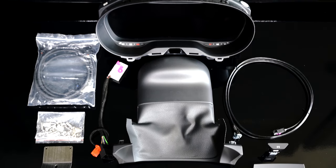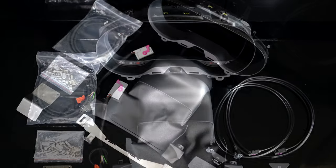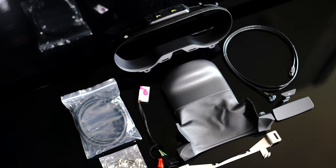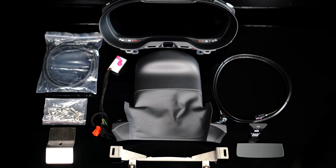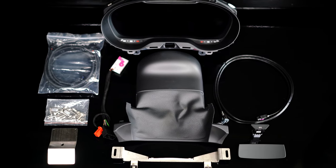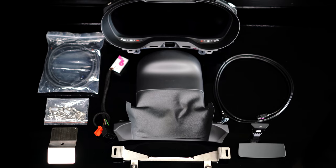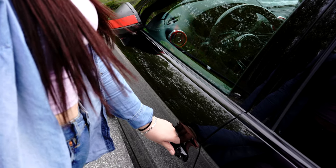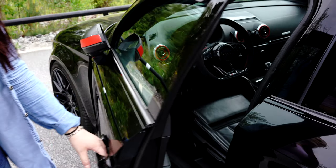You have two options. One is to buy a used unit and take the risk of it being stolen — you need to buy one with lesser miles or you can't match your current miles. The installer needs to have a mile correction tool to match the miles. Or you buy a new one with zero miles, which is much easier to match your miles with and no risk that it won't work.